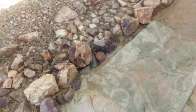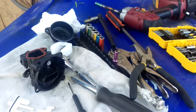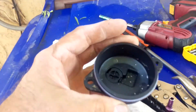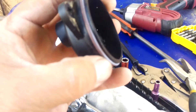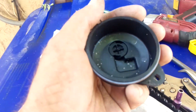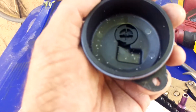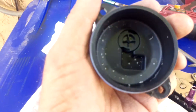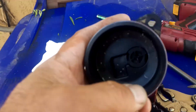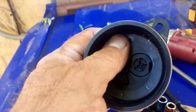Here's what I found. This mower belongs to Mike, and you always think you know what's going on — like when they tell you, 'yeah, I put in some carb spray and it kind of wanted to cough but it won't stay running.' So carburetor clean for sure. But look — see all these little white fuzzy things in here? They're all stuck in the bottom of the bowl.